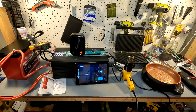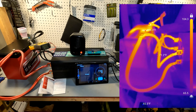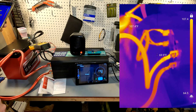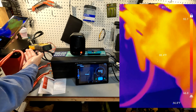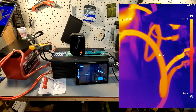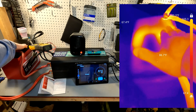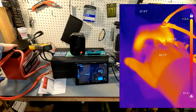After running the test for seven and a half minutes at 156 amps, let's look at the thermal camera. You can see the top of the battery is showing red — the top of the battery case is 105 degrees Fahrenheit, now climbing to 115 degrees. But look at the cables: they're basically body temperature, around 90 degrees. The connections are not hot at all, which is amazing — you can definitely tell where the BMS is located.